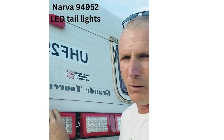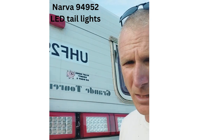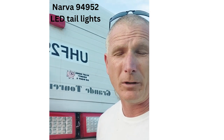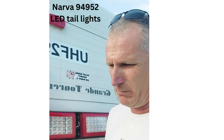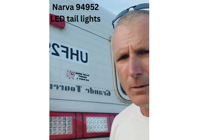Get the whole works out — had a bad earth. They use the caravan skin for the earthing system, for the neutral, and it had rusted and carried on so it wasn't working. Fix up your neutrals, all good. Just pops back in, good to go.